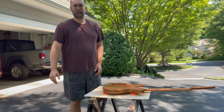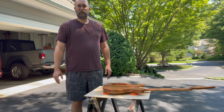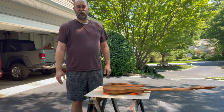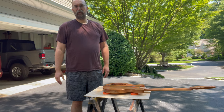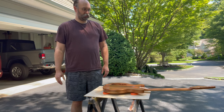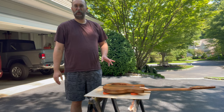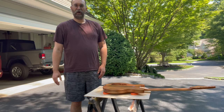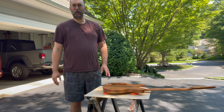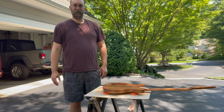I just finished up my wet coat of vinyl sealer. On the back of the can it says it takes an hour to dry, but it's been drying to the touch in about 15 minutes. I'm going to let this coat dry — I have to go back to work anyway, so this will likely sit for hours before I use 320 grit to lightly smooth out any of the vinyl sealer.